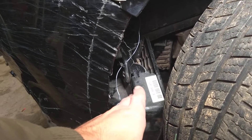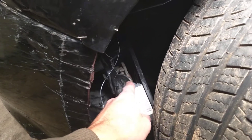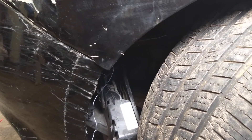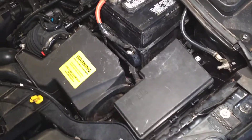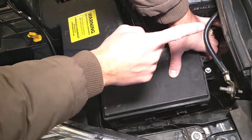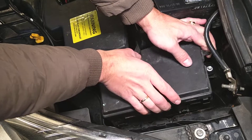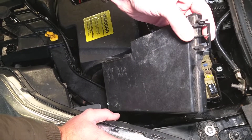Ours is good, everything's perfect with it. The only thing that got broken — you can see here it's the box, and you can see your engine computer inside. So if you want to find the fuse for it, all you have to do is open the hood. You have three fuses, so open that fuse box. There is a clip on the back side — pull it towards the back, then lift up and get this box out. You can see this clip — just pull it like that.